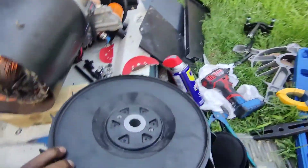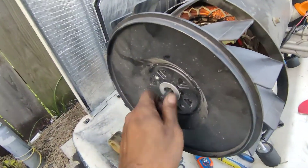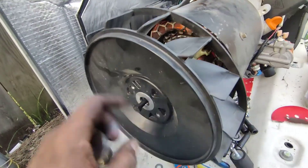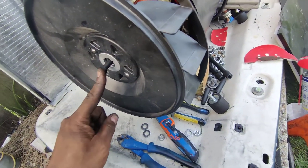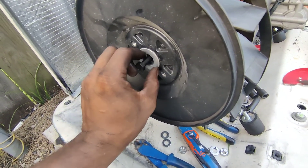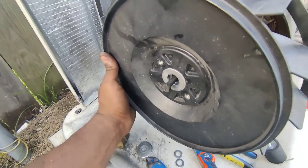I actually broke the fan taking it off — I took it off wrong. When you take this fan off, loosen up this bolt first. This bolt has a washer on it. A lot of people say you have to cut this bolt to take the rotor out — don't do that. Loosen it up to where you've got about a quarter-inch gap, then put your puller sitting on that bolt. When you start using your puller to pull the fan off, you'll have that quarter inch to pull into. Once it pops off there'll be a loud little pop, then you'll be able to take the bolt all the way off and everything will be loose.